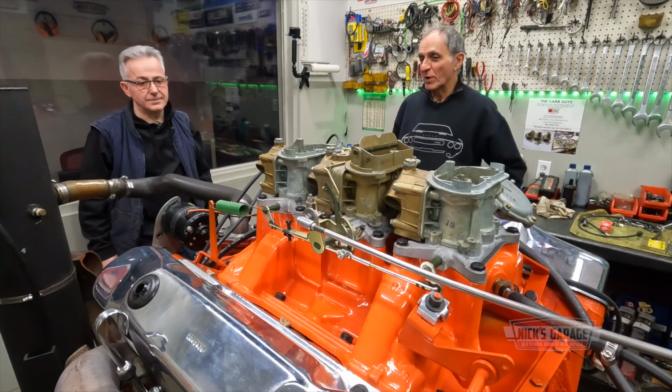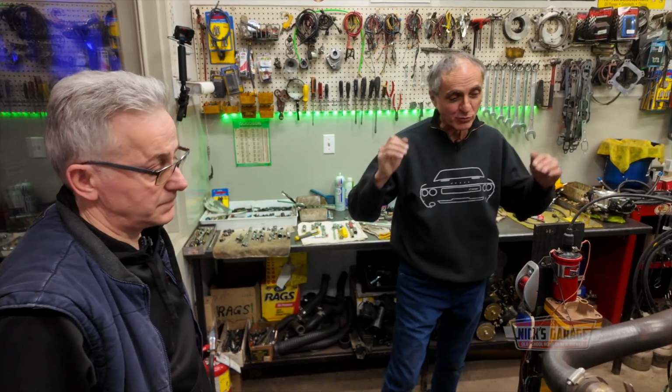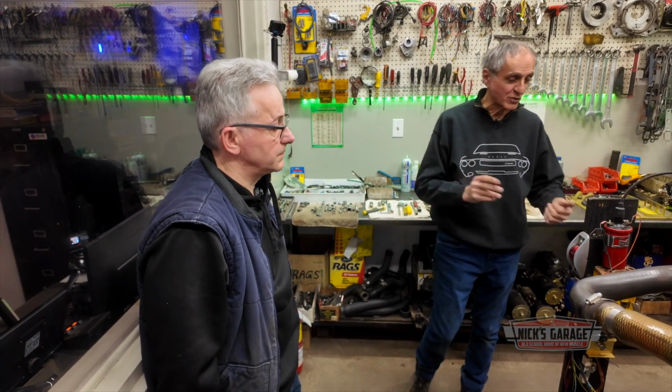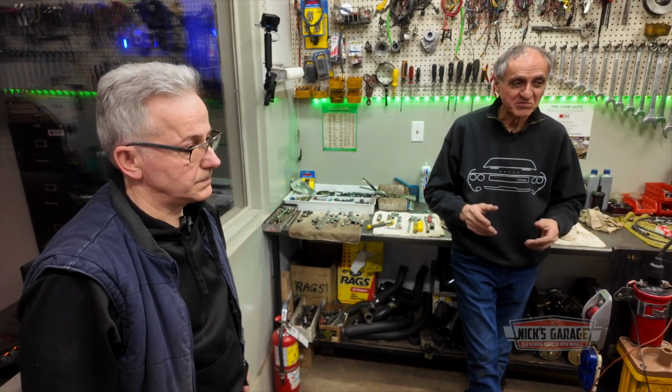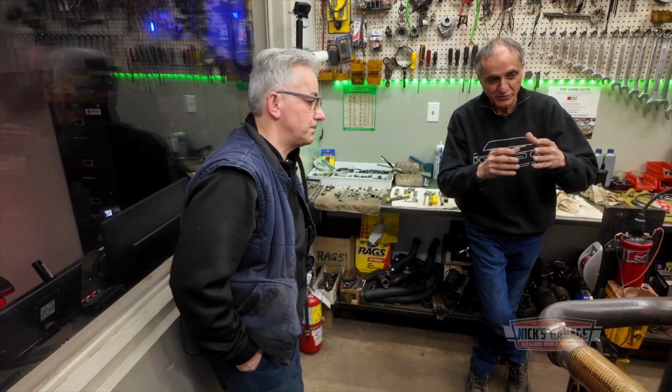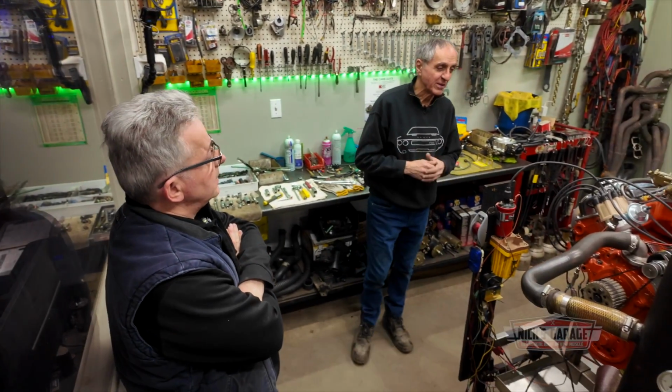It's got 396 horsepower. One good thing is we kept doing test after test after test. The cam's not wiped out. Second, there's no rear seal leaking. Nothing whatsoever. It's consistent. Carburetors don't leak. Air fuel ratio is perfect. I played around with the timing, no big changes at all. It likes what it likes. So I'm happy with the results.